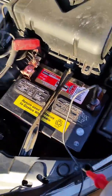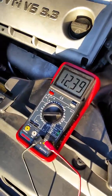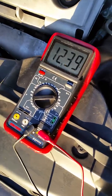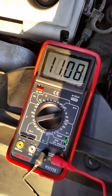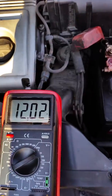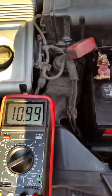I cleaned the terminals, the light went back on. The voltage without it starting is 12.39. Go ahead and turn on the car. This is 12.3 volts, 12.2 — it should be going up to 13, even measuring in here or down here.